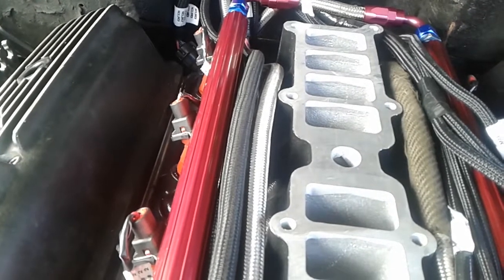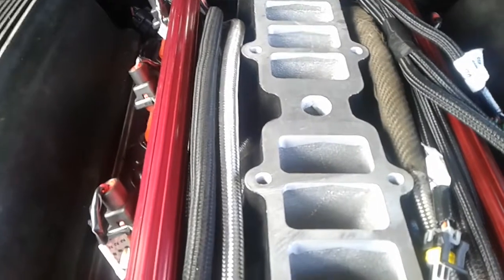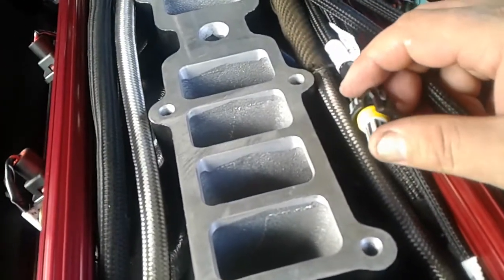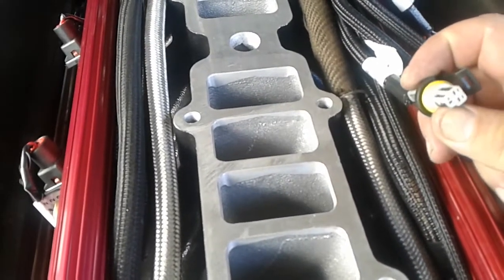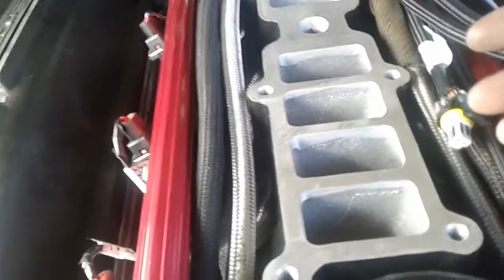The rails and injectors changed a little bit so I'll have to do an update on that. I need to get an oil pressure extension - I bought the special connector for this, the opposite version, and I'm going to extend it down to the oil pressure sensor. There's a little probe in there, so I have a mechanical gauge and also one that goes to the computer.